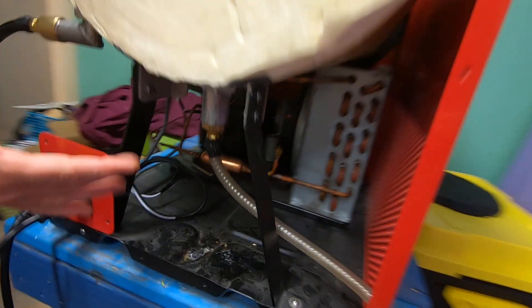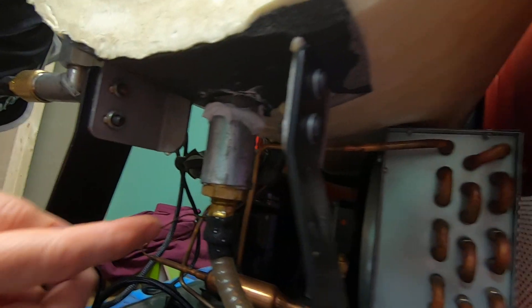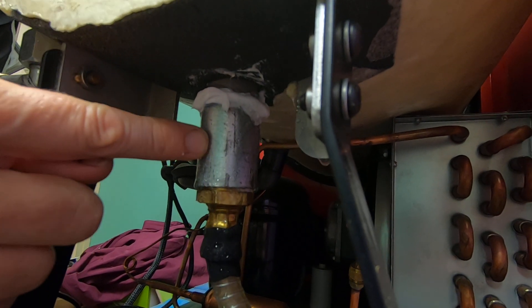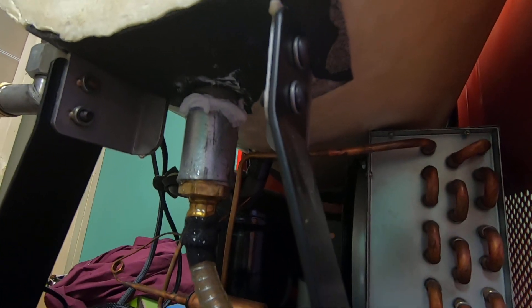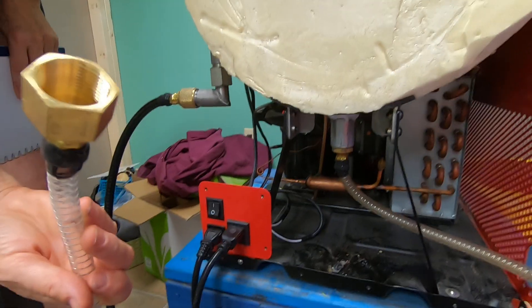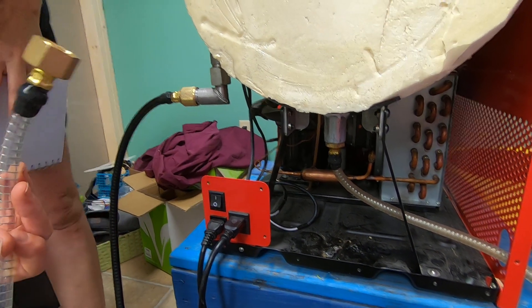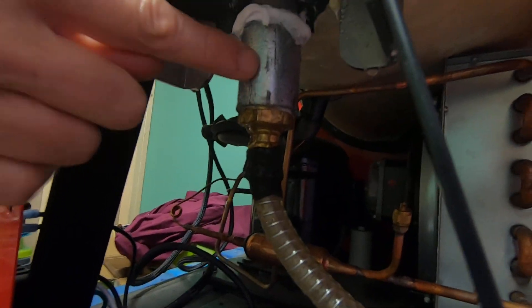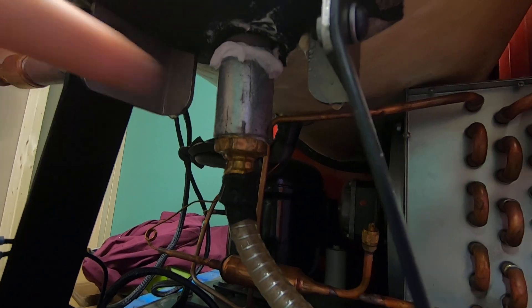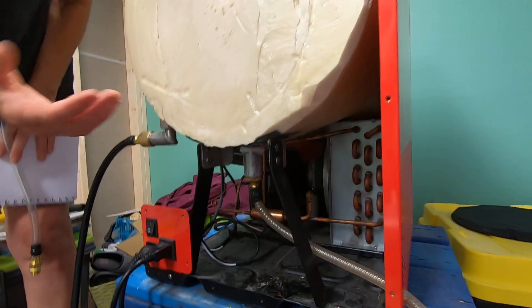The other end goes into the pump. Another issue is where the drain comes into the drum — there's a connector piece that Harvest Right no longer uses, but we did not know that. When they sent us the new hose, it had a female end instead of the male end on the original piece, and we got very confused. This is actually the old hose, but we've since learned that we can eventually take this connector piece off to eliminate another potential issue.